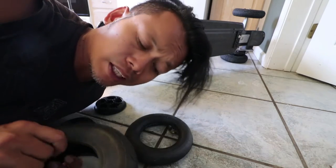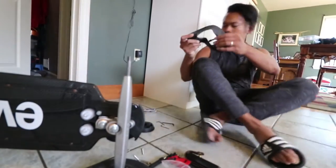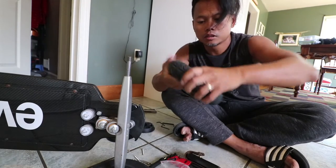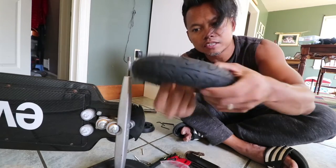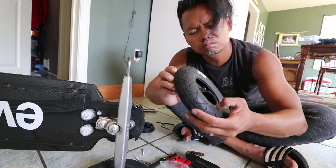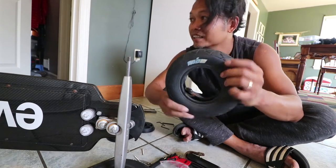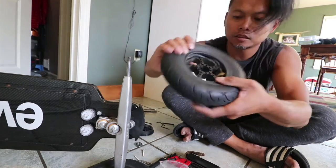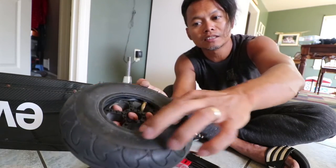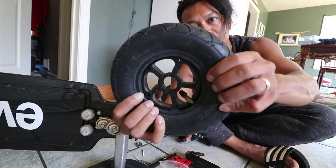I know that from experience. When you install a tube, make sure the valve stem is pointing to the outside of your tire — probably doesn't matter, but the lettering is what I consider the outside; it just looks nicer. When you put the rim on the tire and tube, just make sure the tube is all the way in and not resting or sticking out onto the inside of the rim itself.